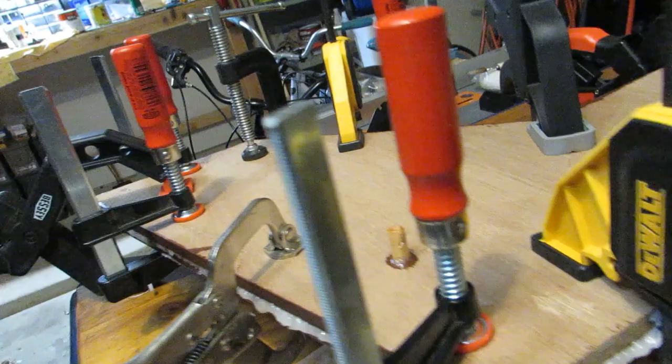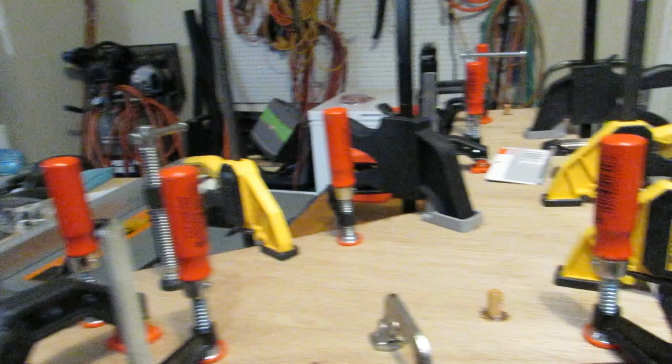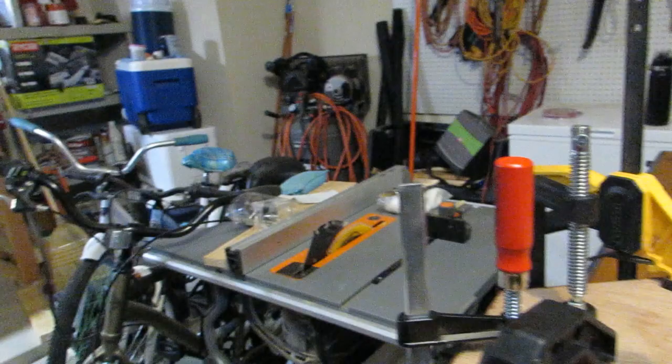Hopefully we'll get that coated so it'll be waterproof. I'll probably have to come back and put some resin on that. I thought I got all six sides on these — I counted one, two, three, four, five, six — but I missed that bottom. We'll get it. This thing will be good and waterproof, I'm not going to have any water seeping into the edge of that plywood. I've been wiping this edge, wiping that seam right there, trying to get all that excess epoxy out. Could probably trim it with a knife later on.